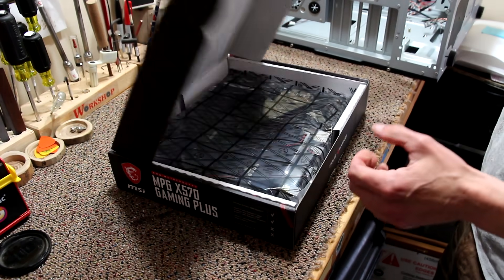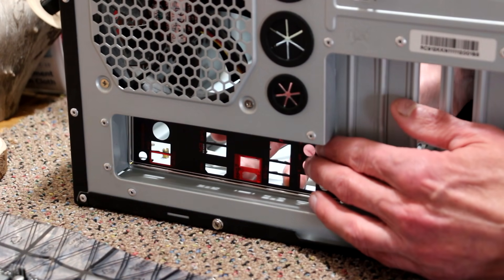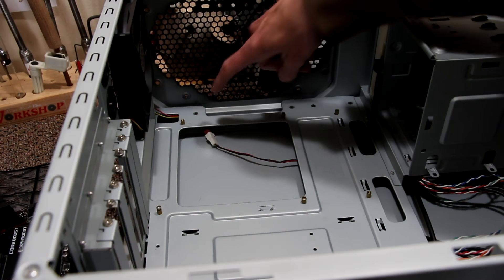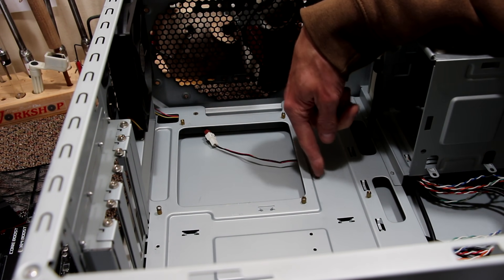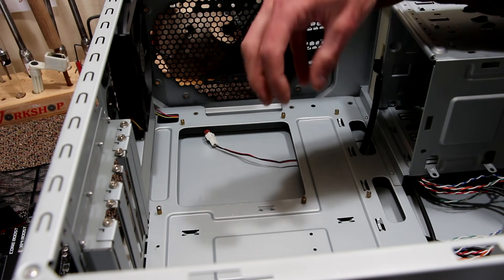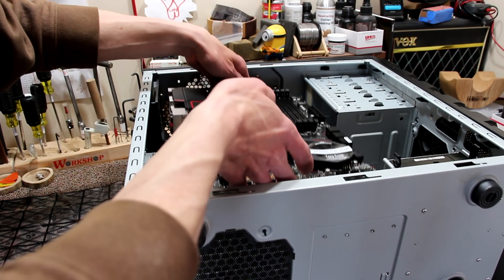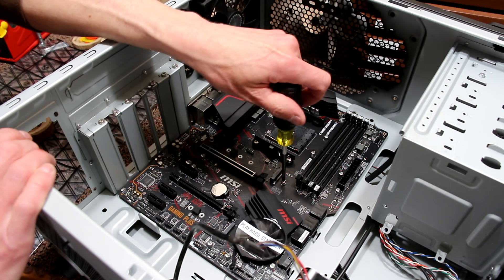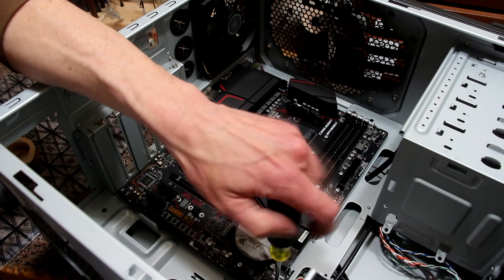The first thing we're going to unpack is the motherboard. This is the thing we need to start with first for this build. Most motherboards come with this little plate that covers the jacks and all the plugs on the back — we've got to install this before we put the motherboard into the case. The first thing I need to do is make sure these little brass standoffs are in place. Since this is a rebuild of a case I was already using, these standoffs are already installed. But make sure that you have them in the right place according to the specs that your motherboard requires. This one requires nine different standoffs — just make sure you double check the manual for your motherboard. It should tell you where you need to locate those standoffs. Always make sure you tighten these screws down by hand. Please don't ever grab an impact driver or anything like that — you don't want to do anything that could crack this motherboard.